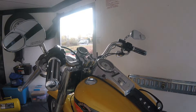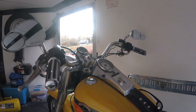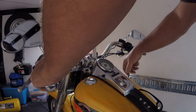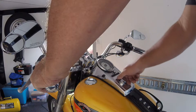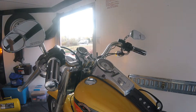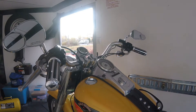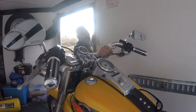Now you get back in, got your key fob, put it in my pocket here. Now with your switch off, turn it on to run, turn it to accessories, hit the four ways, turn it off — three flashes: one, two, three. Now watch, there should be no lights come on when I come around the other side and shake it. See — no lights.